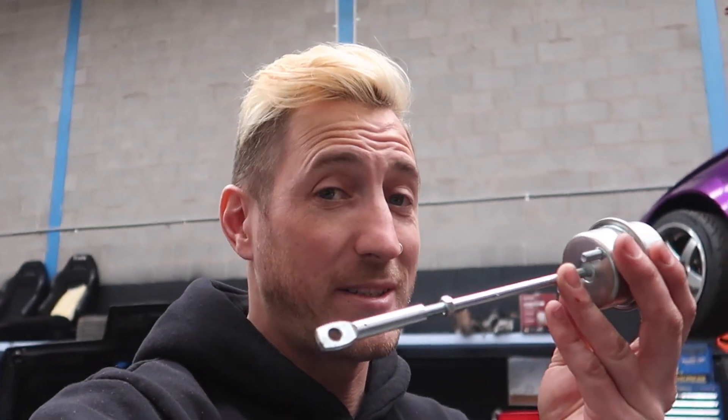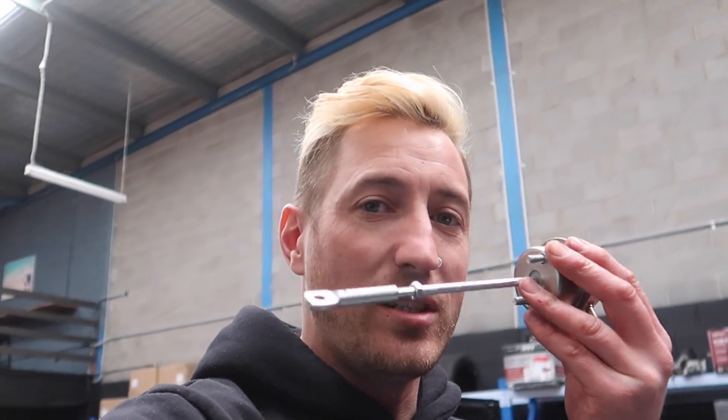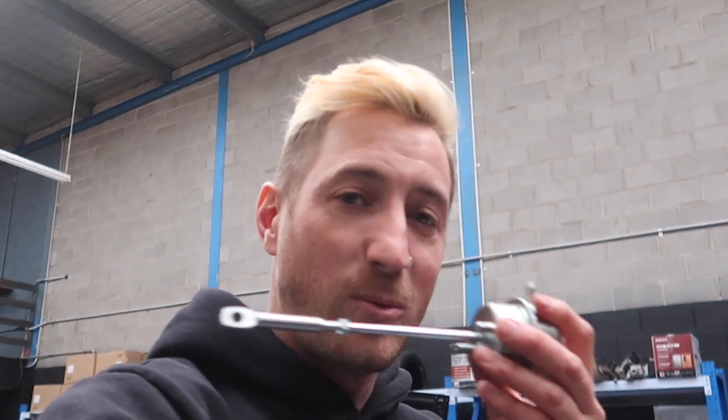Today we're going to fit a boost gauge to our car, and I'm also fitting the actuator to the turbo because we really need that fitted. At the moment it's just held shut, which basically means it's free boosting - it'll just keep building boost until the motor blows, which is not what you want. So we're going to chuck this on. There's a little bit of welding and cutting to be done, and I'm going to tack the dump on with the gasless MIG. When we do the full exhaust build we'll use Waz's gas MIG for a really tidy result.